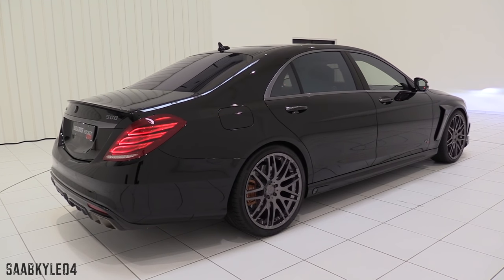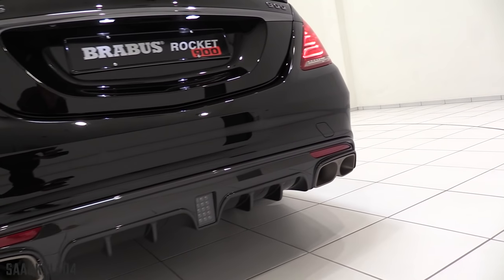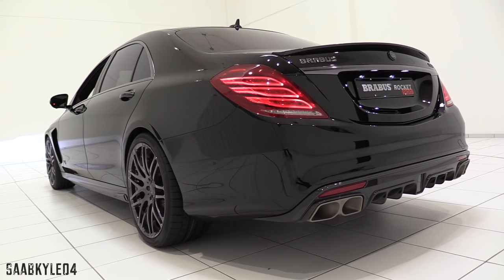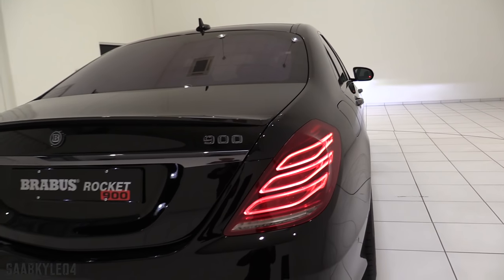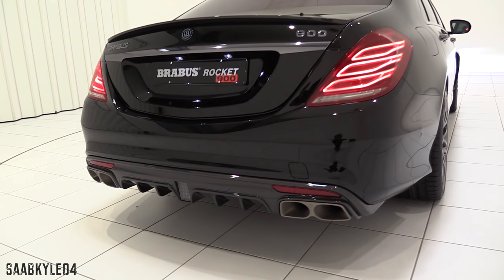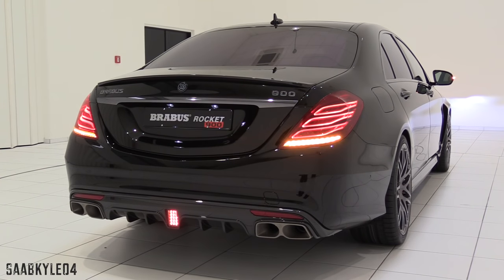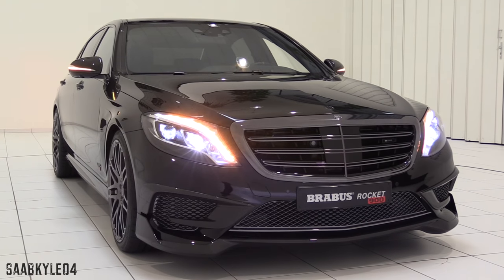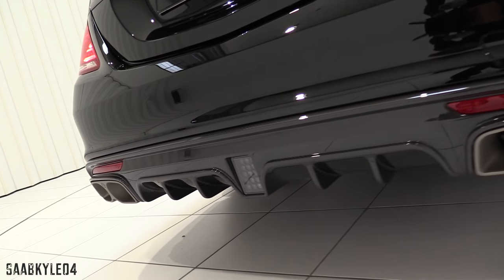As we've covered in previous videos, for the first time, all body panels are now made from aluminum. Aluminum also makes up many of the suspension components and structure to decrease unsprung weight, complemented by lightweight forged wheel options. Lightweight high-strength steel makes up the majority of the passenger compartment for an extra level of protection and rigidity. The seats are lighter, while the spare tire well is even made from carbon fiber. This all helped the new S65 drop around 220 pounds or so over the outgoing model. Torsional rigidity has also been improved by 50%.